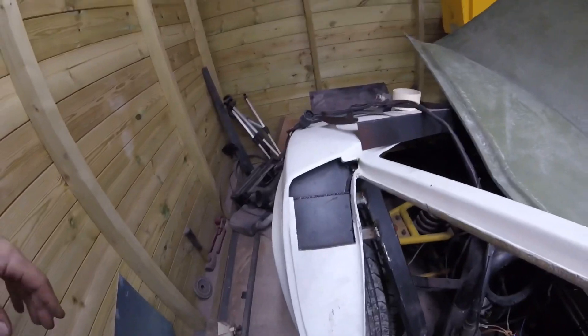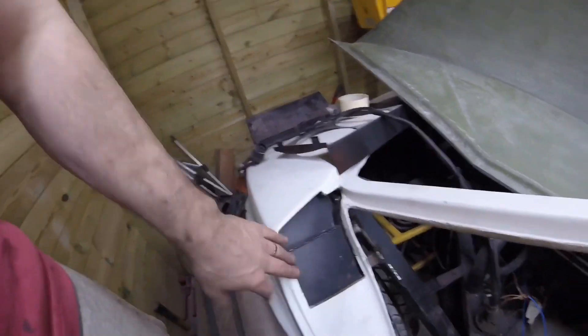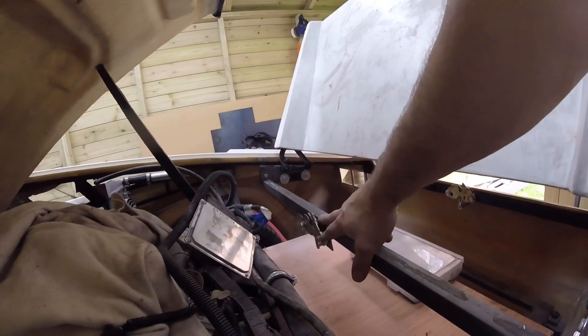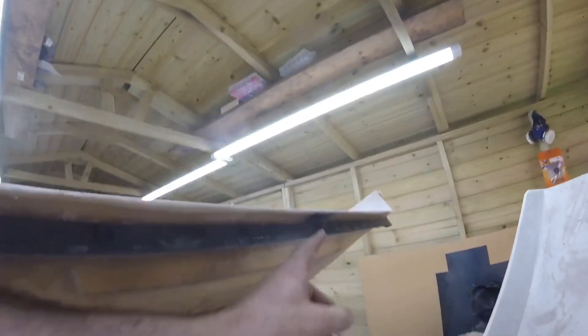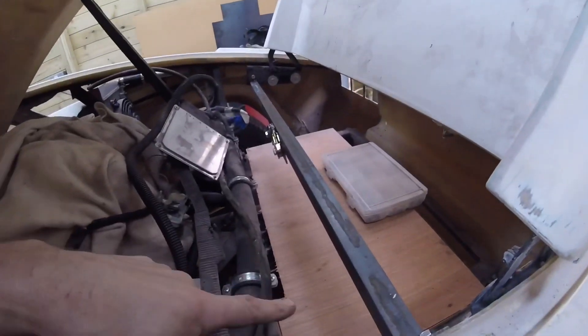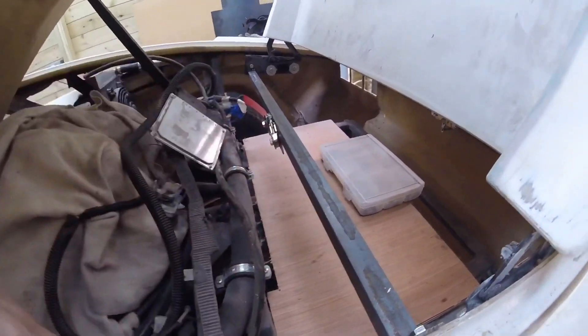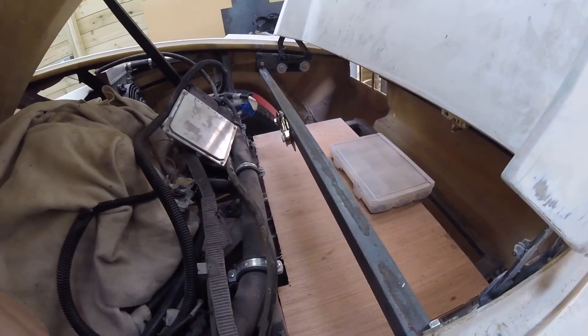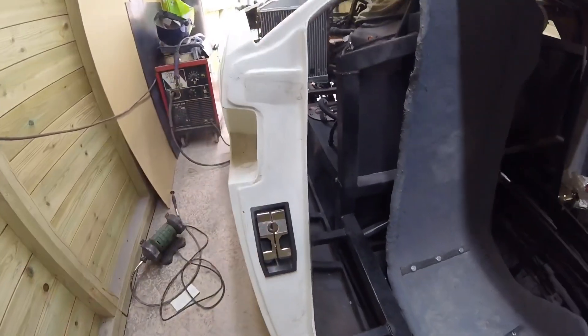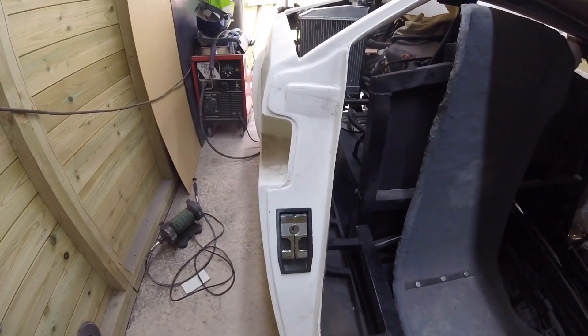We're doing a partitioning from the engine to the boot. I've got the lock on and the striker pins already in — that's working. This needs to come out, that's why it's bolted in. That one's already done with the striker pin on it as well and was already working. We're seeing where the aluminium panels are going to be because they all have to be able to come out to take the engine out. I've also mounted the pulley system for the boot lid and the engine cover.